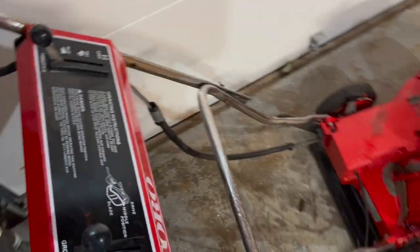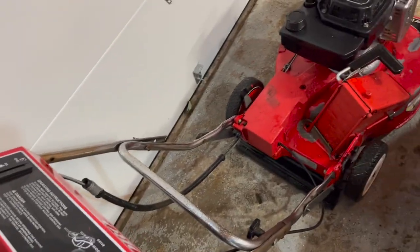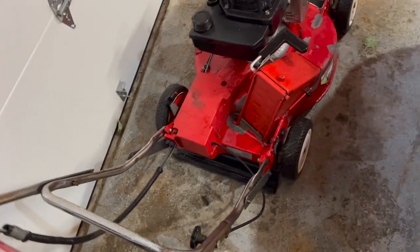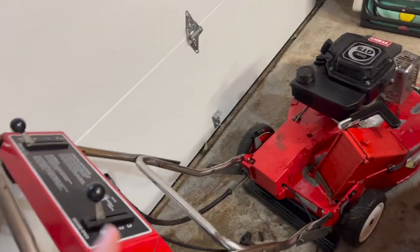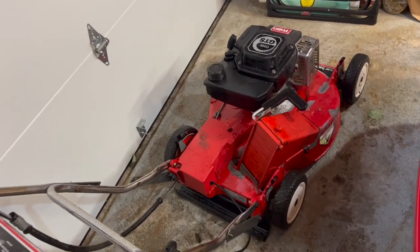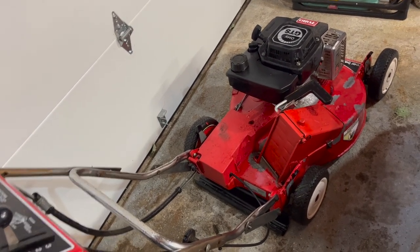You've got some of the controls that you lost from lawnmowers in succeeding years. For example, you've got a throttle control. No mower today has throttle control. In fact, I think they started deleting that in the mid 90s, and I think that was an EPA thing where they were designing the carburetors with fixed jets that could not be adjusted and were designed to run at one speed only. That was definitely an EPA thing.